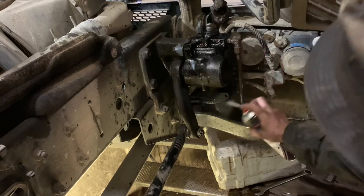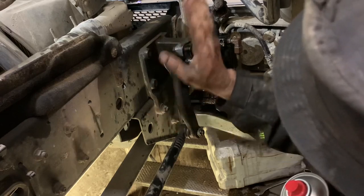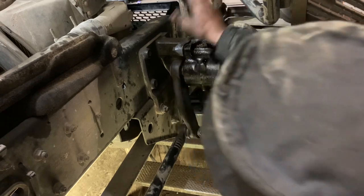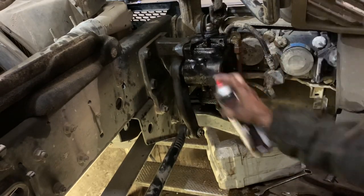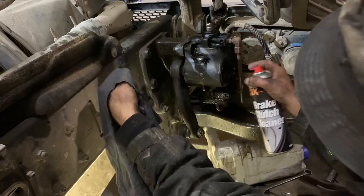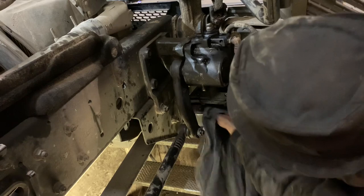So I know if it's leaking when I start it up. I'm going to put the steering wheel straight so it's as if the truck's pointing forward, and then put this steering UJ on. Because the wheels are straight when I come in, if I put the steering wheel straight now it should still be straight when it goes down the road. The steering wheel's not right — I ain't got the UJ in the right place. You need to take it off and readjust it.